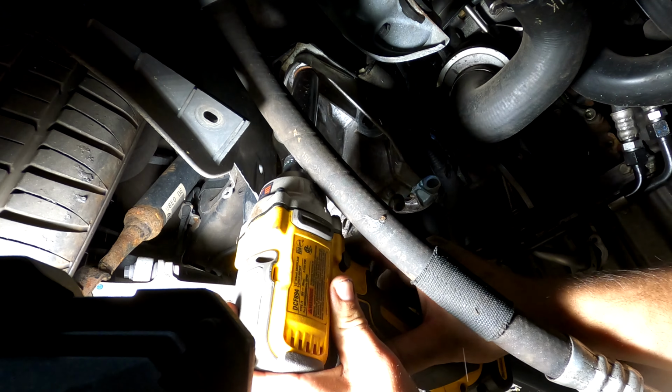And then it shoots it out through the top here to the rest of the engine and distributes oil to all these wear surfaces up in the engine, and then it just rains back down into the oil pan and gets sucked up again. So that's kind of how the oil pump system works.